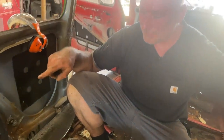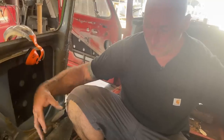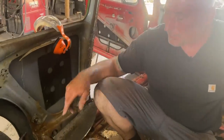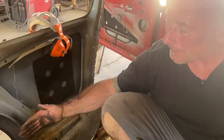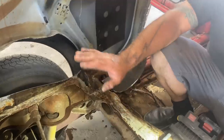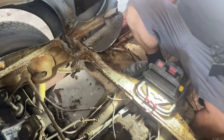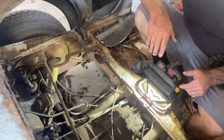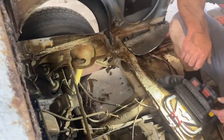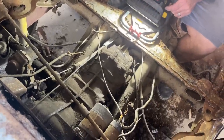So the little levers or swing arms, as they are, that go out to the tire, they ride up and down, thusly twisting that. When you lower the car, a lot of times people will take the spring plate off and rotate it so that it lowers the car and reinstall it. But the problem with the Volkswagen is when you do that, the tires get a lot of negative camber. You see VWs and they're always kind of squatty. They're narrower on the track on top of the tire than they are at the bottom. This type of lowering that I'm doing is major surgery, but it's going to keep the tires in their orientation that they are now.